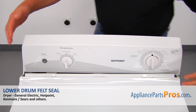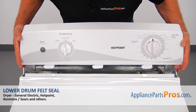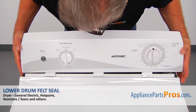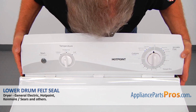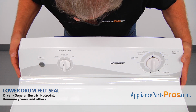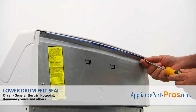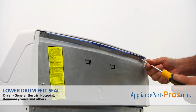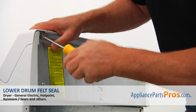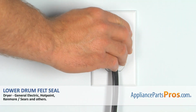Alright, next I'm going to install the control panel. We're going to put these 3 tabs at the bottom into the 3 slots. And then we're going to move it to the right from my position. Now I'm going to secure this control panel with 3 screws. Plug the dryer in and check if it's drying properly.